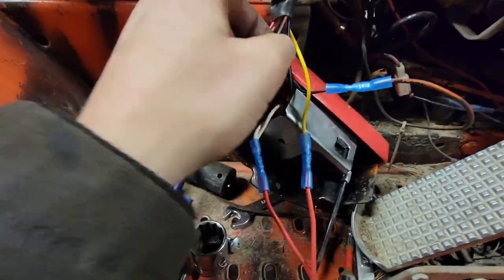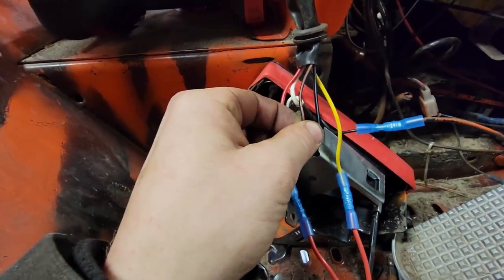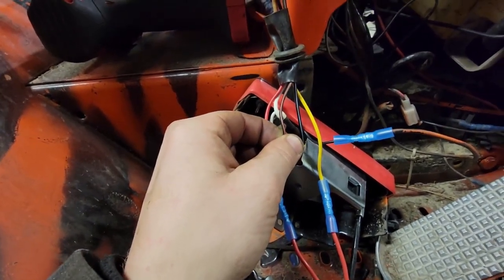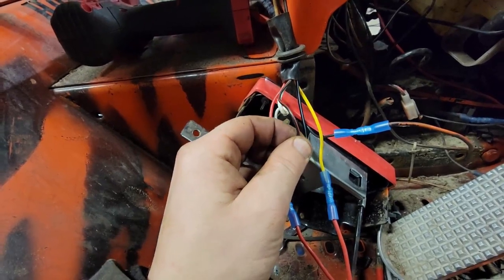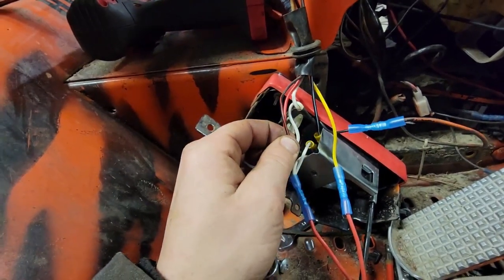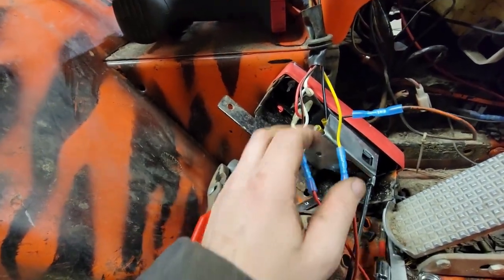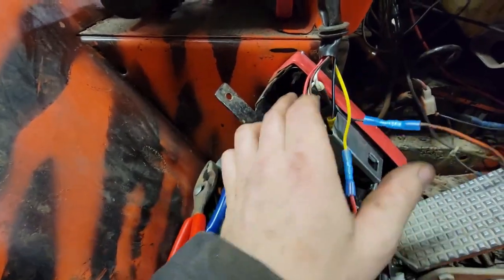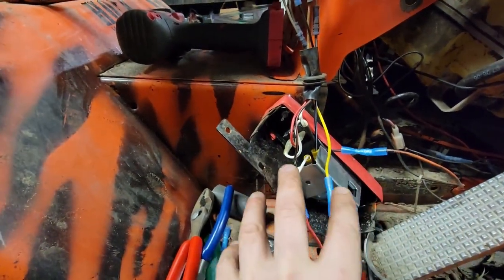Also there's a black and red wire in there — that would be a kill wire for inside the motor. I'm guessing it's for the electronic kill switch on the carburetor, but don't quote me on that. I just know this is a kill wire for when it's in the off position. And then obviously there's a black ground in there that goes up here as well. That's pretty much everything that was in there.